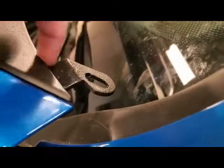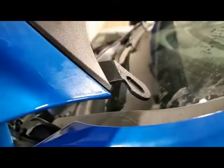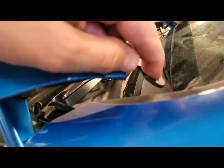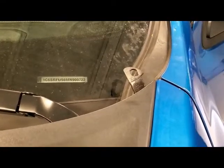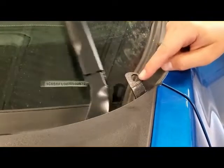So we went in and installed the bracket on the driver's side. There should be a little gap in here, and the top part of the bracket should be pretty flush with this plastic piece on the hood of the TRX. When we close it, it's going to make even more room, but we're leaving it a little loose right now. We're going to test the windshield wipers — we want to make sure they're not hitting it when they come on. The wipers are not touching, so we're good right there.